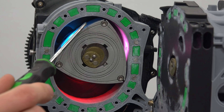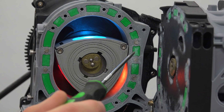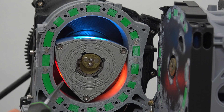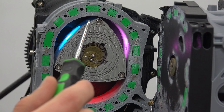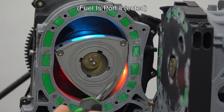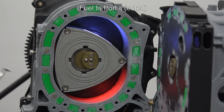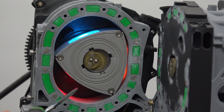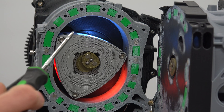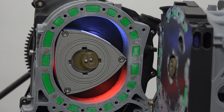Up on the top here you can see the intake stroke, which is always occurring within this region. Then over here you always have the power stroke occurring in this region. You've got the exhaust coming out right here. So you've got intake, you compress that air and fuel, get over here, you hit your spark plugs, the power stroke pushes this thing over, and then the exhaust stroke forces out those exhaust gases. That's occurring in three different locations at the same time, and because there are two rotors, that means you've got six cycles continuously occurring within this engine.